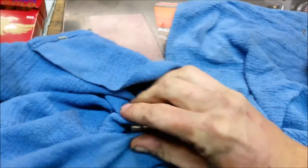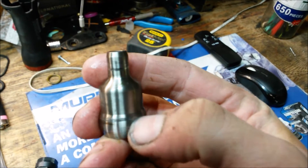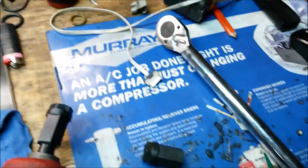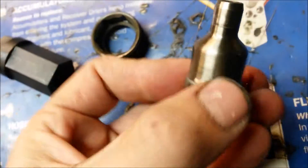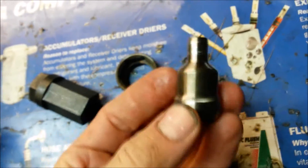You want to take a real good look at your nipple cups. We're coming out with a bulletproof nipple cup in the next couple of months. If you see that ridge right up at the top, that's where it actually rides against the lock ring and that is where they wear. The ones from Bostec are made of soft steel — that ridge is where it rides against the lock nut, and even half a thousandth of wear at that top ridge means more slack and it won't seal properly against the O-ring.